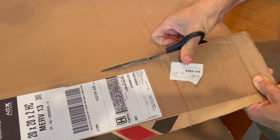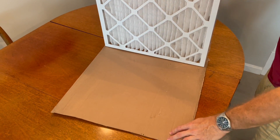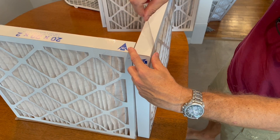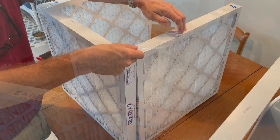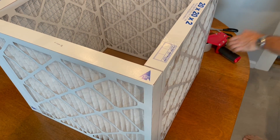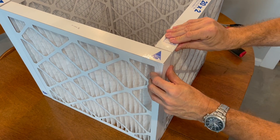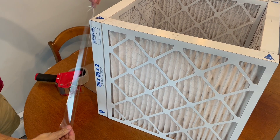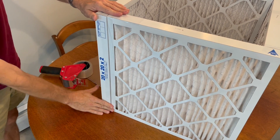What I'm going to show you now is how to make a cube version of the filter. You need four filters to make the cube, and I'm using the cardboard from the box the filters came in, basically just building a square with four filters, sealing all the edges. I've got the airflow arrows pointing towards the interior of the cube, and I tape everything together. I tape the cardboard onto one side of the cube, which is going to be the bottom. With four filters instead of one, we have much lower resistance to airflow, so we can get a lot more CFM through the fan.